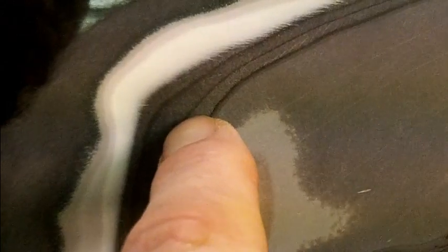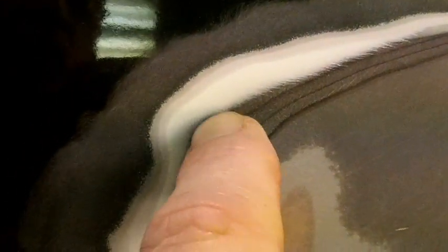There's more primer or base coat, don't know which. Maybe that's just another layer of clear. That could be 2 different layers of clear. Then, we have another layer of something else. Maybe a 3rd layer of clear, don't know. But look at that, that's body filler. There's another type of body filler in that ring. And I haven't feathered any farther back, but that looks like more primer or paint. And we're back out at our clear out here. That's 3 sets. There's original and 2 repairs, because this wasn't done right to begin with.